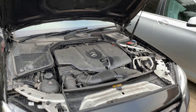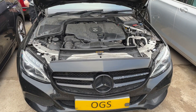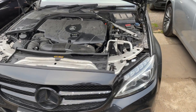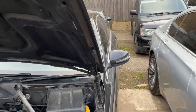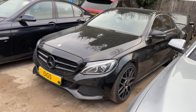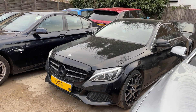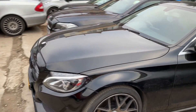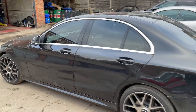Quite a loud noise, and then after a few seconds it quietened down. This is a symptom that the chain is stretched. The car is going to go in the workshop to have it stripped and we'll show you what we found. After the first start up the engine runs fine with no noises, but this is an indication that the chain is stretched, and if you keep using it like that you could eventually end up with a chain failure and an expensive repair.